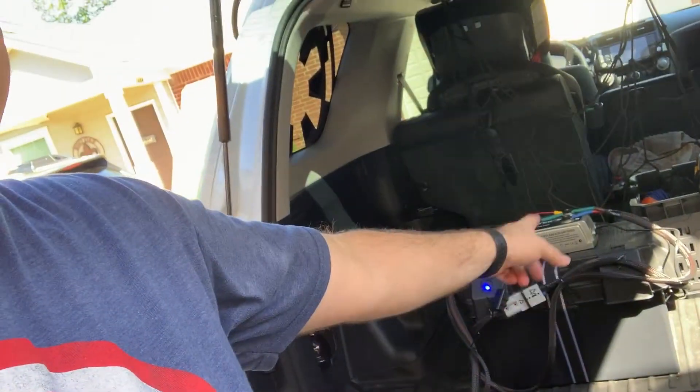The downside to the system is it's a sealed lead acid battery. I do have a lithium on order — it's coming on the slow boat, so it'll take about two months. I have a BMS and everything. I'll require a different DC-DC charger because this one is only designed for flooded lead acid, sealed lead acid, and gel batteries — it cannot handle lithium. But essentially what I'd get is the same unit again in a version that can also manage a lithium charge profile.